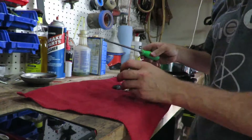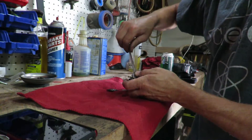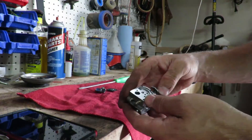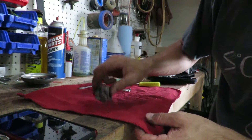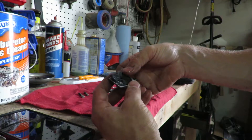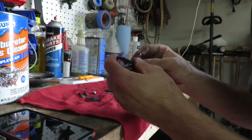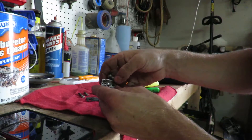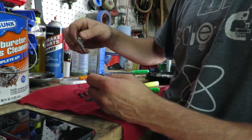I'm going to go ahead and take that carburetor off and give it a good cleaning and see if we can get it to run after that. We're at the bench again, just taking it apart. These are the cover and the diaphragm, and I don't believe I've ever been in here before on this one. Right now I can see — there's a bunch of debris in that little filter right there. As I'm putting stuff into the carb cleaner with the idle screws and the pump gasket, I'm pulling this off and look at what I find — it's like major dirt stuck right onto the top. This definitely needs to go into the carb cleaner. Look at how dirty that is just moving it around. This will sit for about a half hour to an hour, then we'll take it out and try to reinstall and fire it up again.